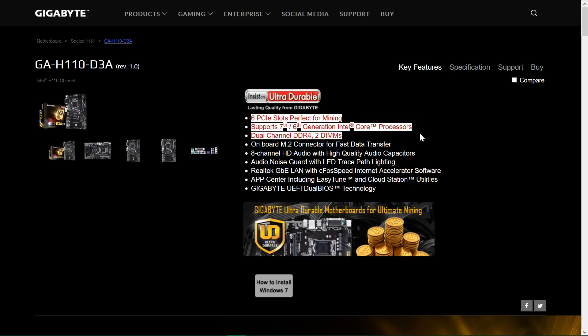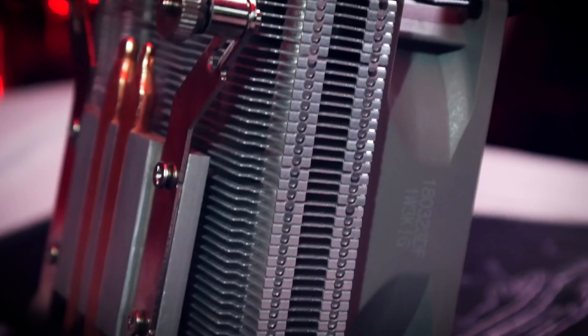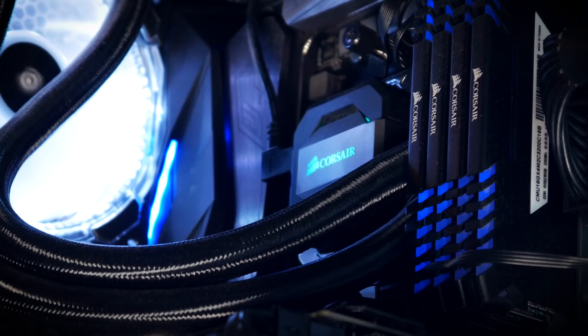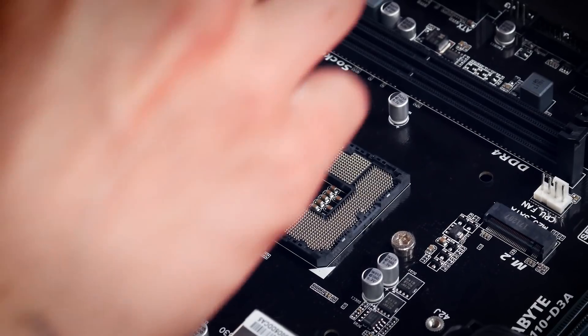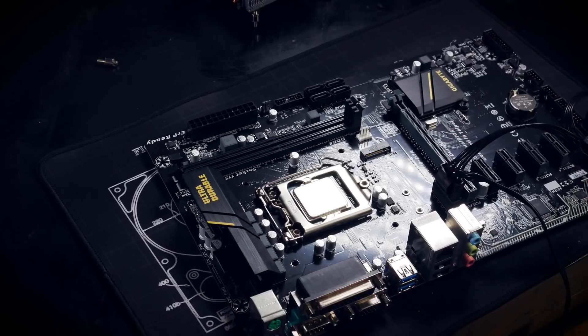Back to our 6600K — our rig should use around 90 watts more with the CPU attached. What's not ideal is that the H110 motherboards don't like overclocking, so we can't tweak things further to optimize. As we can't overclock, the low-profile cooler will be enough. If you wanted to go for crazy CPU overclocks, a bigger cooler or even water cooling would be recommendable, but we don't want to set back our numbers for the experiment even further.